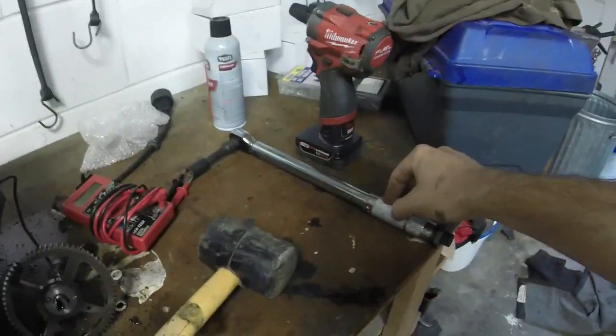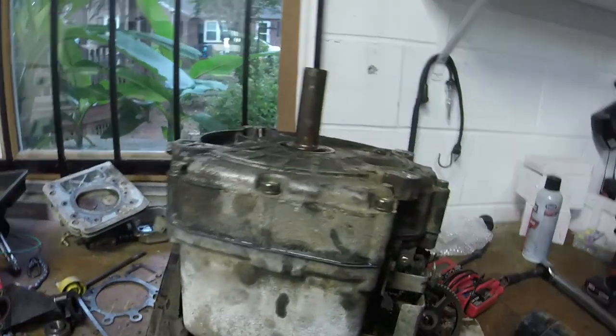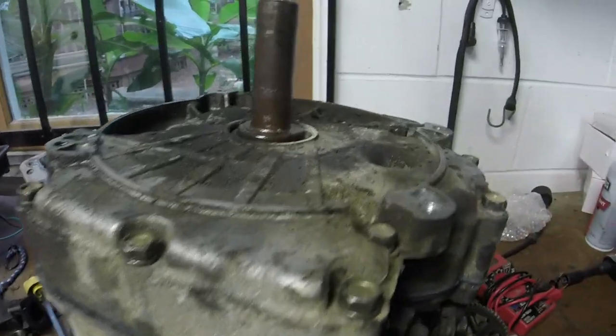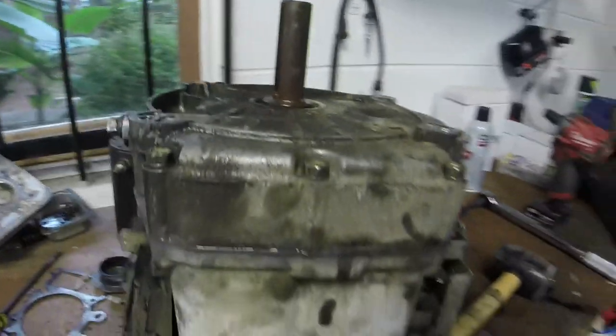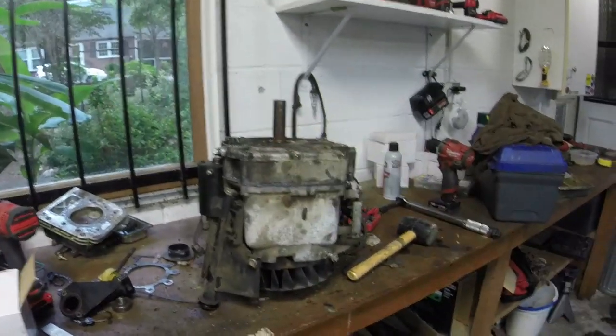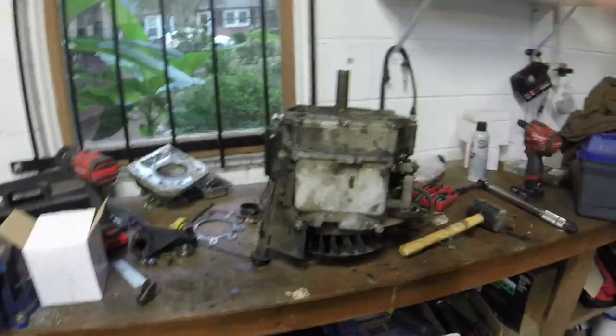And then I got my small 3/8 inch torque wrench out. I torqued them to 20. I think it's like either 15 or 20, depending on the engine. An extra 5 foot-pounds is not going to kill it, although some people think that it will. None of the bolts stripped out at 20 foot-pounds. And they got Loctite and all that mess on them.